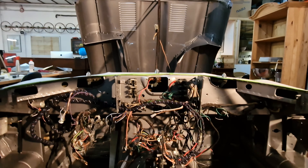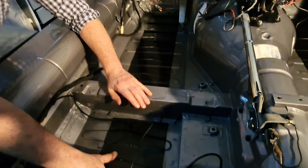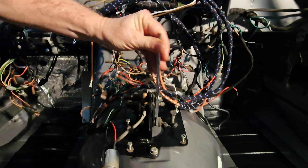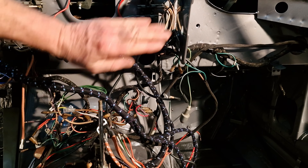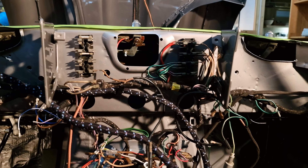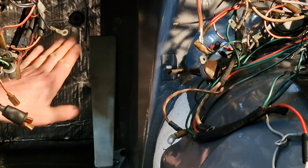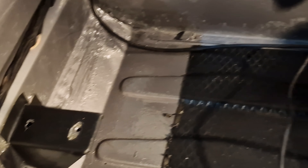Let's have a look on the inside at what's in the shelf and what we have done here. We have done the sound deadening — these are kind of original mats. We have done the wiring harness. We have installed the handbrake — that is all ready. We have installed the gear shifter — this is the automatic. We have installed the fuses, the complete wiring harness is in here, and the wiper rack stop function. We have installed the accelerator pedal box and the brake pedal box. There's an edge cover which is original. The rest will be coconut mats and then covered with carpets.